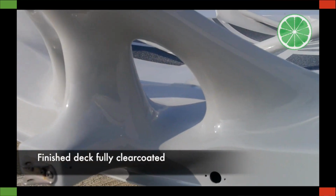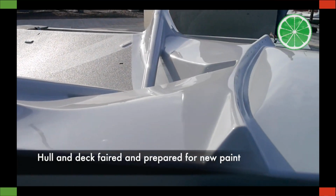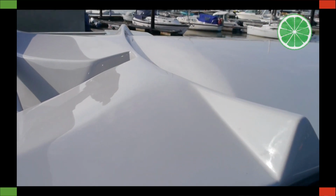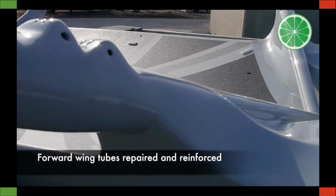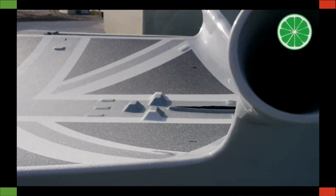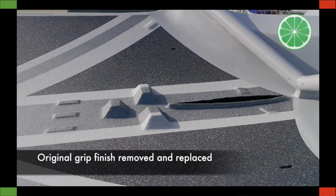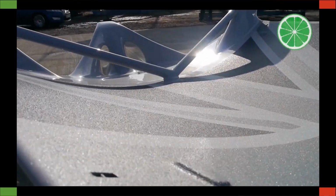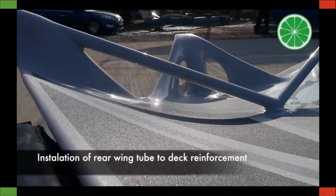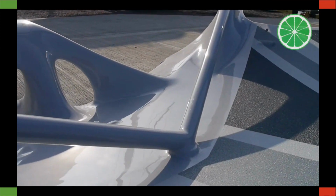You probably didn't want to give away your trade secrets, Pete, but I've always sprayed the Durepox primer with about 35% thinners. Actually, I use quite a lot of thinners, and I tend to walk around the job more times to build it because I keep the finish a bit neater. But you go somewhere else and someone uses much less thinners and maybe a bigger fluid tip in their gun. Chris, when you were spraying Durepox, what was your favourite setup for it?